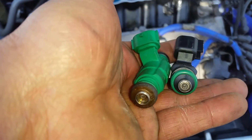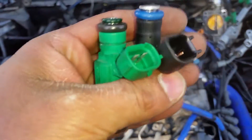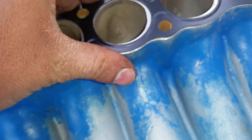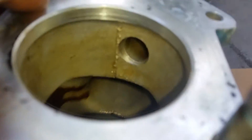The bottom side looks similar — it's only a little tad taller, so I don't think it's going to make a huge difference. Now comparing the upper intake manifold: I put the gasket on. See all that material that can be ported out to give you better airflow? I didn't really feel a big weight difference on these ones, but this one is bored out too. Compare it to this side — this one is not ported out, so you can just tell the difference.